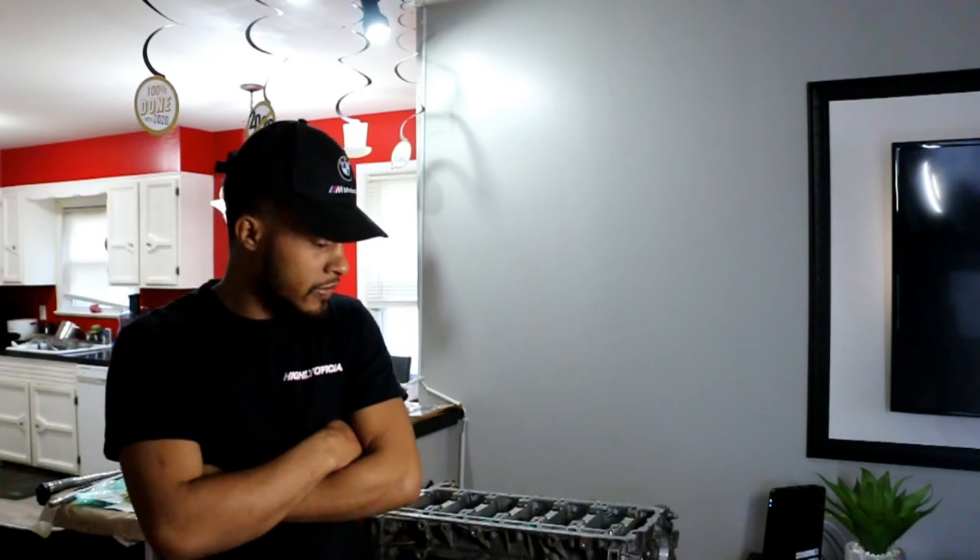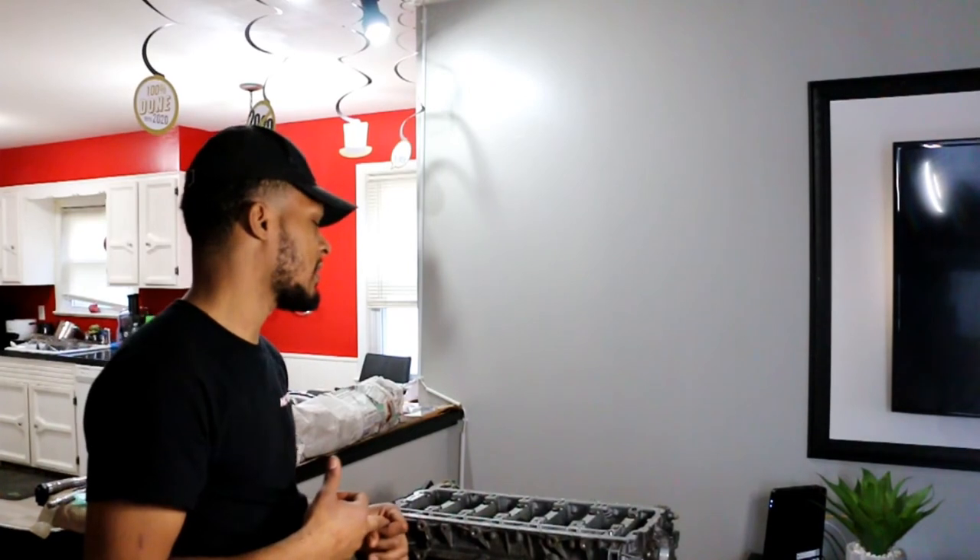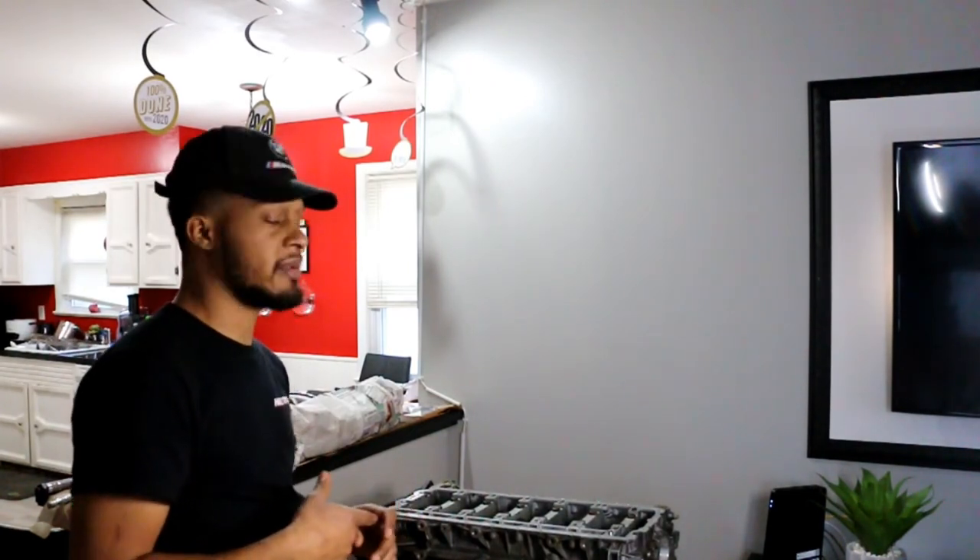What is up YouTubers, I am back with the M Killer series. I know I haven't been posting lately — it's been hectic working two jobs and editing is difficult. Behind me I have an N54 block that I disassembled. To get up to speed on that process, visit my Instagram at blueprint_auto. I had the block sent to the machine shop — had it cleaned, decked, repaired some broken threads, and also had the pistons and rods measured and balanced. You'll see more of that later on in the future.